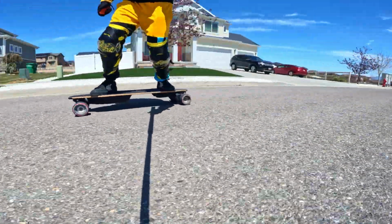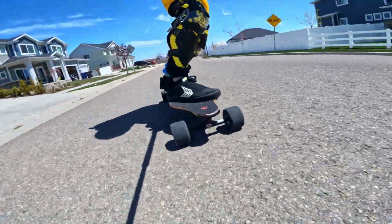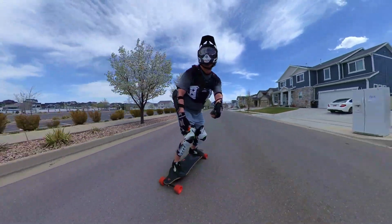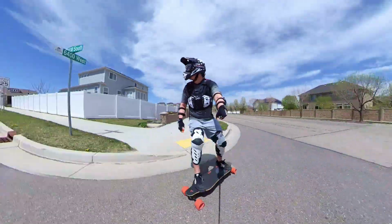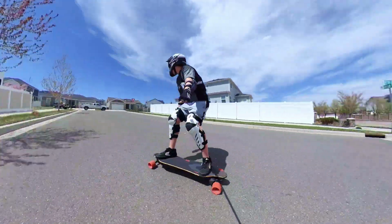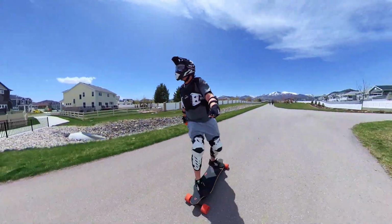Not only just that, when you're on a belt drive, you can switch around the pulleys. You can get 32T, you can get customized 34T, 38T. You can change the size of your pulleys when you're on a belt drive. It's much easier to do that. You're kind of stuck with your gear ratio if you're on a gear drive.